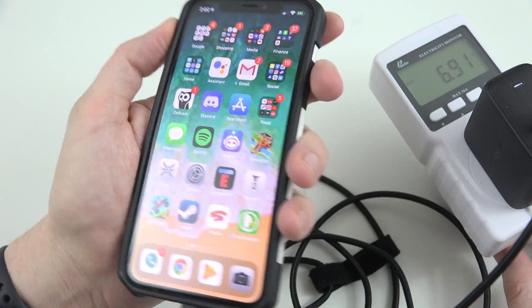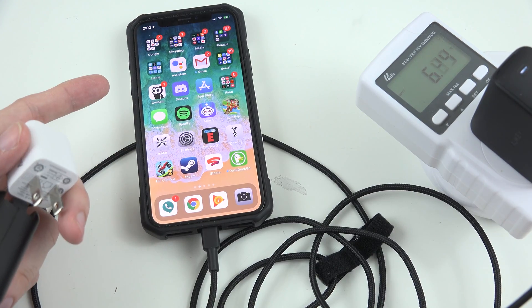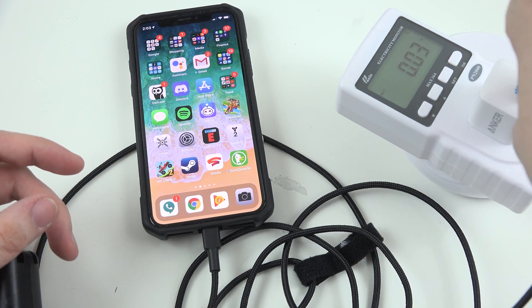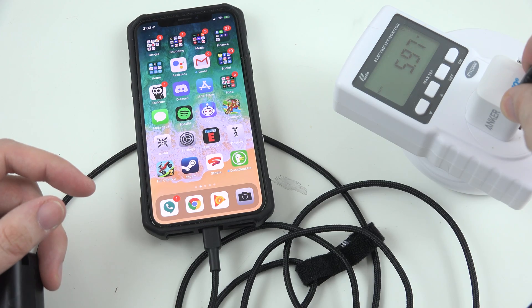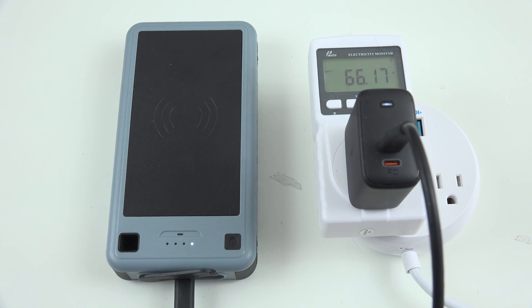This is just the iPhone X — not the 11 or anything newer than that. I've never seen my iPhone 10 charge very fast, so I don't believe this device has fast charging. Normally when you plug it in you'll hear a second beep if you have your sound on, and this device has never done that. My battery is almost full, so just for fair comparison, this is just an 18 watt one — let's plug that in and see if it goes any faster. We're getting about 6. Let's try one more thing — this is a 30 watt power delivery — and we're getting about the same.